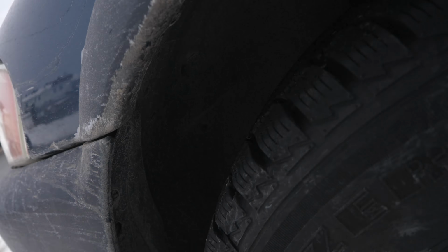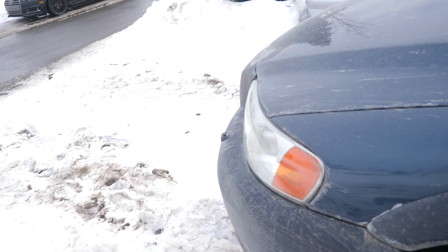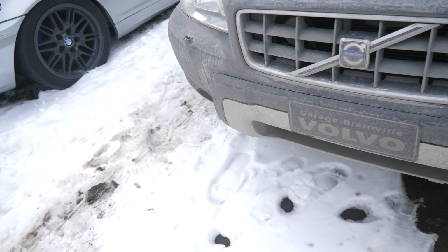And then you're going to go in the wheel arches and you're going to be removing, let's see if you guys can see here, those little Torx right there. Those are Torx. I don't remember how much, but they are Torx. I think they're 30s, if I'm not mistaken, 30 or 35 on each side.